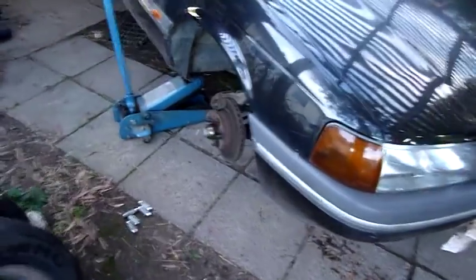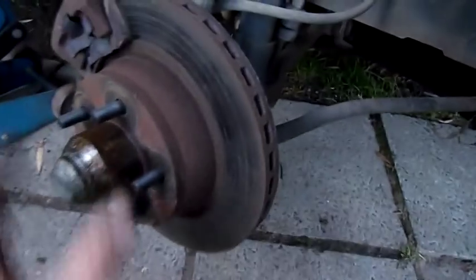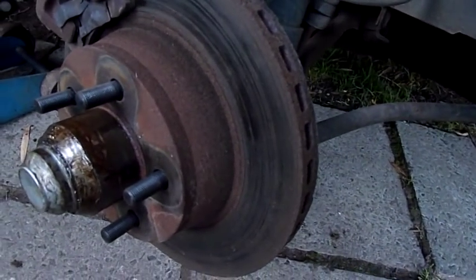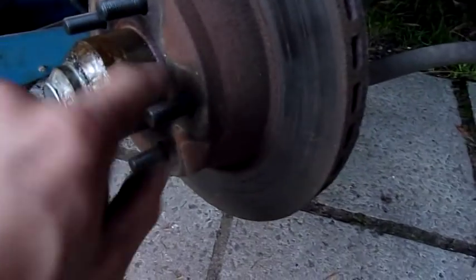Well, I suppose this is the easiest way to do this. I'm going to put all new brakes on it and everything like that. The brake hoses don't seem to be bulging or breaking down in any particular way, so they're good. That's all good. This wheel was not even bolted on tight. Like, I just spun the nuts off by hand. I didn't even have to use the lug nut wrench. Kind of troubling, but hasn't ruined anything.